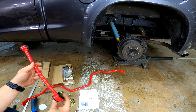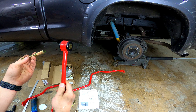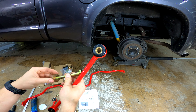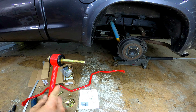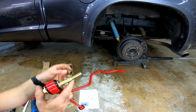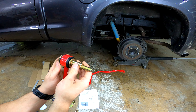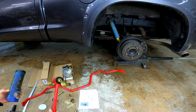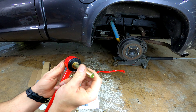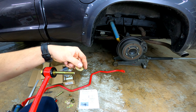Let's see if we can figure this out. One side is smaller than the other, so it only works one way. So we have the bolts, a washer, the end link, another washer, and the spacer. This will get bolted right to your frame. Before I do that, I'm going to use just regular multi-purpose grease here. I'm going to grease this bolt because mine, like I said, is seized up. You want to keep this greased in the event you ever want to take it off — just a good habit in general.